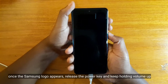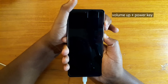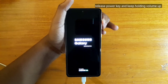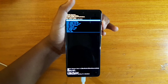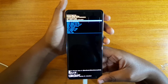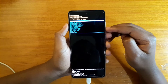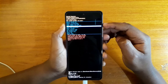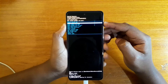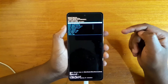That's what I'm going to do right now. You're now booted into recovery and that's simply how you do it. Once you're in recovery, you just use your volume keys to navigate to whatever option you're interested in. And once you get to the option you want, you just use the power button itself to select that option.